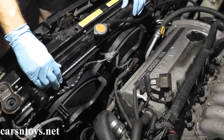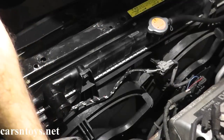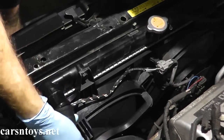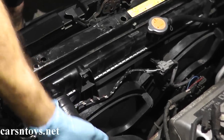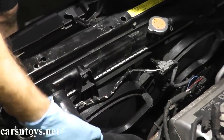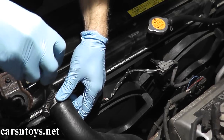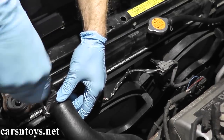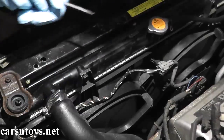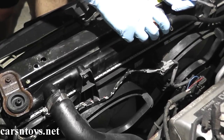Make your connections and double check everything — you have your two connectors, the hose on the bottom, and everything mounted top and bottom. Then grab the upper radiator hose, reinsert it, and secure the hose clamp. These hose clamps don't have to be extraordinarily tight — just good and snug. Check for leaks and reinstall a little bit of the antifreeze you lost.